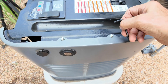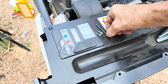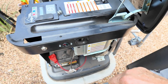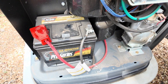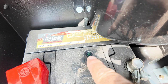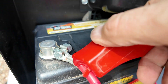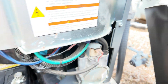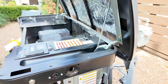We'll do a visual inspection of the battery. I don't really have to worry about adding liquid to this — it's a maintenance-free battery — but you do want to check the peephole just to see what's going on. I don't see any corrosion on the terminals at all, so we're in good shape and everything else looks good. I'm going to button this up and then we'll start with the air filter next.